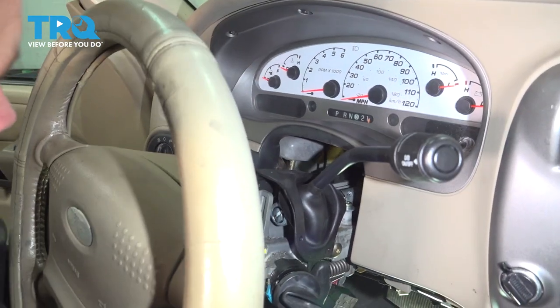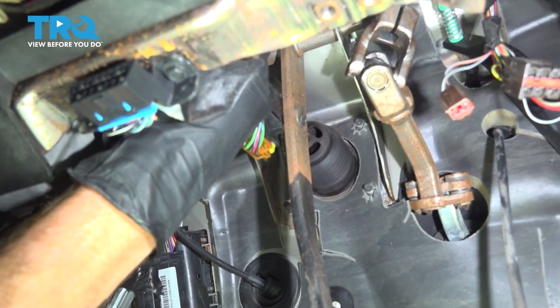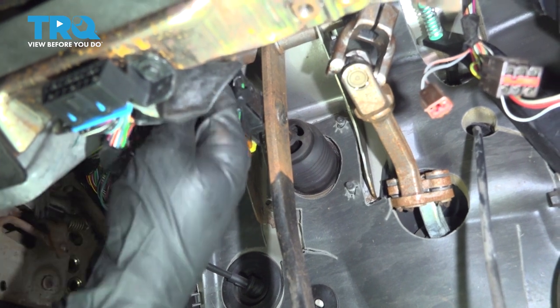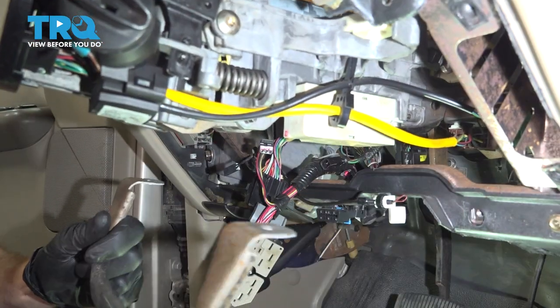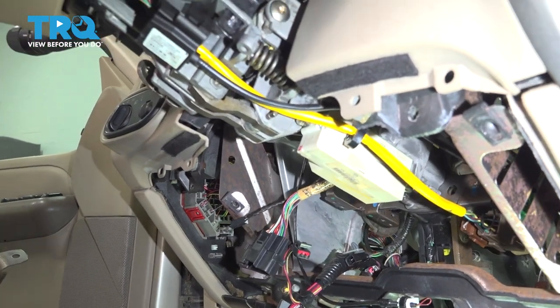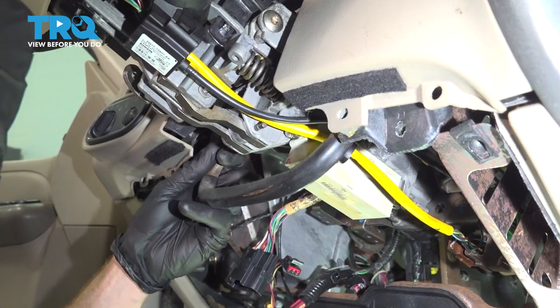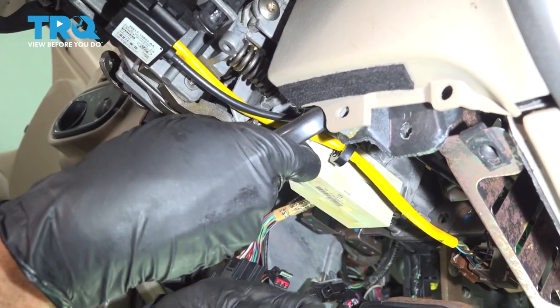Let's lift up that steering column. Now I can start putting on my mounting nuts — I'm going to start with the far forward driver's one. Get that on there a little bit and leave it loose. Now we'll go ahead and tilt up the steering column, line up the mounting bolt holes, hold that up, start my bracket on there, and then start each of my mounting nuts.